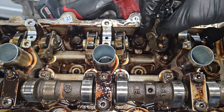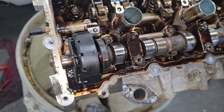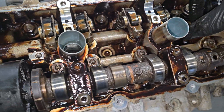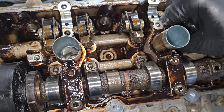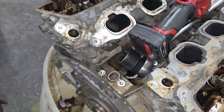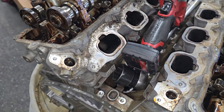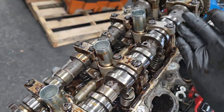Supposedly it's designed to combat the ticking issue, however I'm still hearing stories of a few ticking issues. Anyway, I don't need these rocker arms — I never reuse rocker arms, lash adjusters, or lifters. However, I will be taking these camshafts out of here, all of them. I want all four. When they get this engine back in the box, there won't be any camshafts in it.